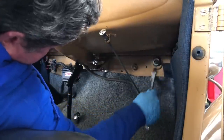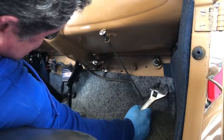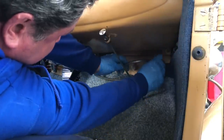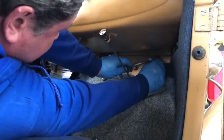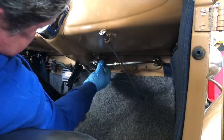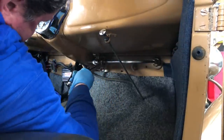I felt tension there. Is it straight? It doesn't have the jiggle in it anymore. It appears to be straight. Perfect. Now the inside fuel line — what I like to do is put this side on first and just do it hand tight, get it to where it's just sort of snug. Now you have a gentle idea of where that goes. I adjust the valve so it's straight with this pipe. Now I have already observed this, so I know it is straight, so I will go ahead and put these two together. I'll take my wrench and tighten these up. It already looks so much better.